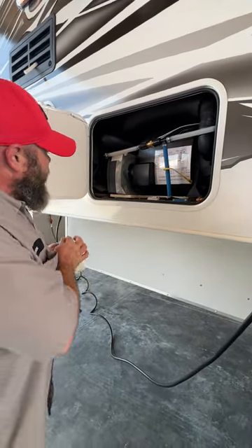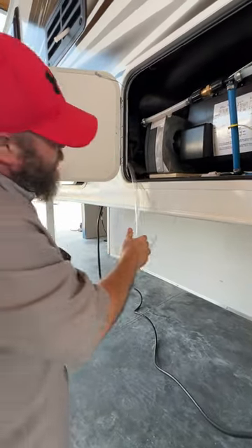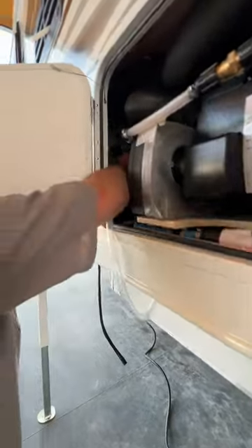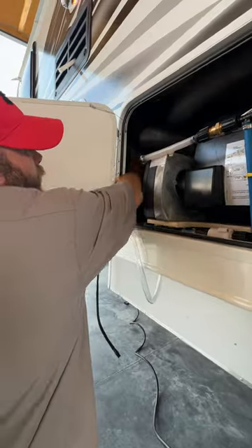The only thing I'm showing you inside here is you have your hose here, the one you go to winterize. There's going to be this valve right up here. Right now it's set in normal operation. When you go to winterize, you would just turn this upward, and then you would have your antifreeze that would siphon through this hose to winterize your coach.